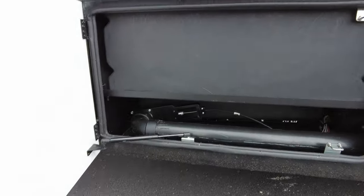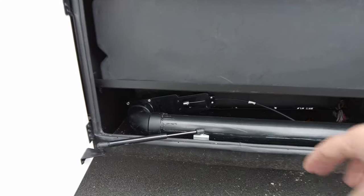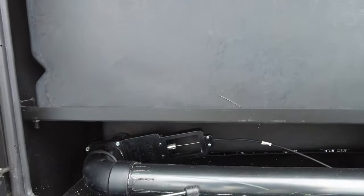This is your gray tank back here — you can see that cable valve. One thing that requires adjustment over time is that cable has a little set screw, and over time the cable might stretch. It's just a matter of adjusting that set screw so it's actually pushing the gates all the way closed.